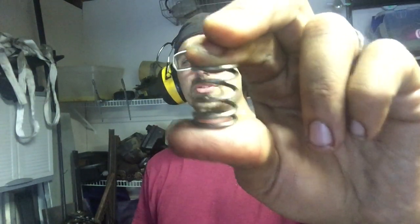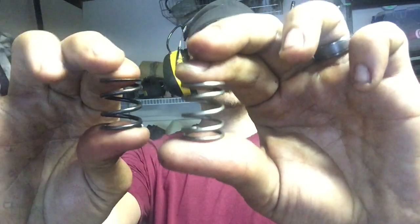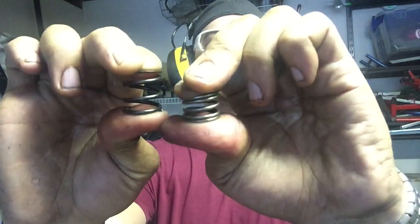So I wanted to test something, because the question always is: do I need to put bigger valve springs on if I just remove my governor? There's only one way to test, and that is switch out one of the springs — or both. But I'm going to do one to see if there's really a difference. I'm going to go from the stock spring, which I can push with just my fingers, to an 18-pound spring from Go Power Sports that I can just barely push. You can tell the difference — this one's way beefier. So we're going to replace one, take the valve cover off, and run this thing full out to see if the stock spring pops off.